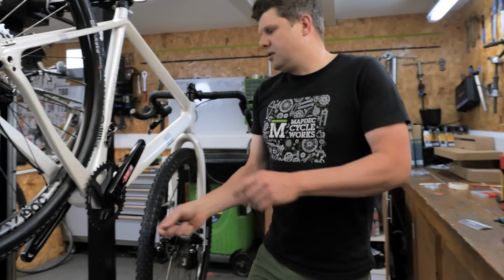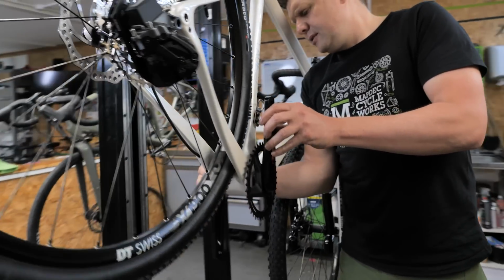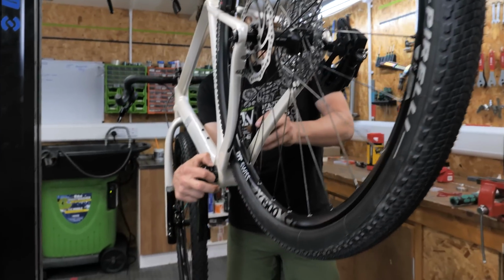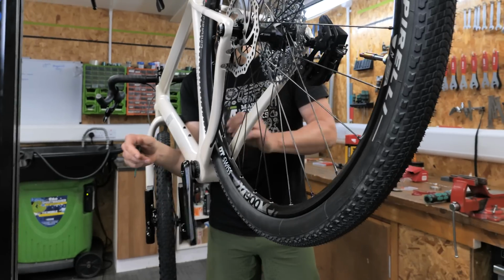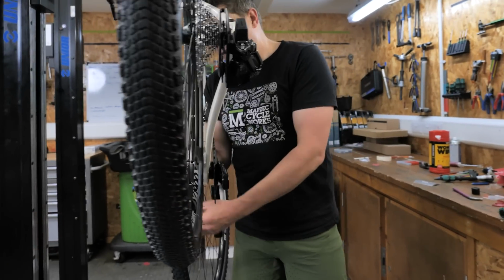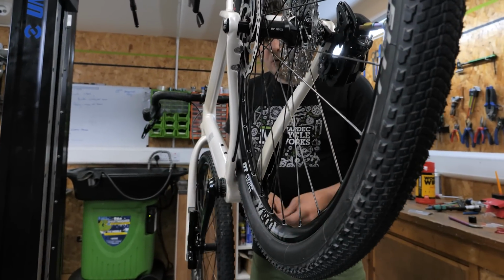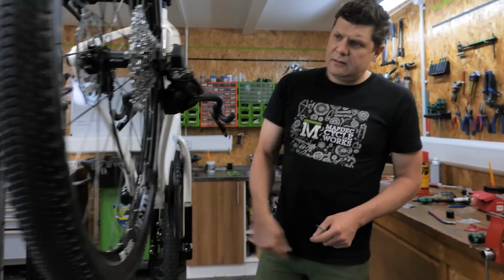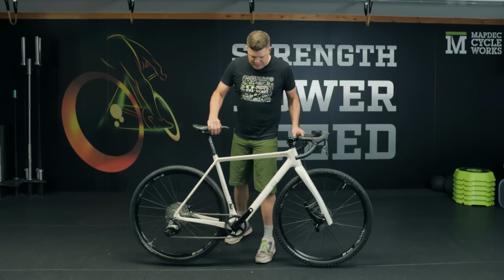Dreams. And with this, we've got one more tiny little step. Just bring that preload bolt up just until we're touching. We're taking out any lateral play, still got good rotation, and that bolt, carefully bring that up. Does not need to be very tight. And we're done. Here we go then, project complete, and doesn't it look absolutely amazing?